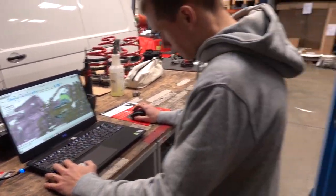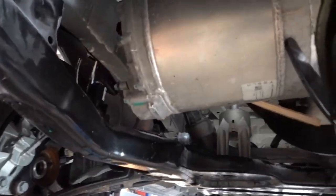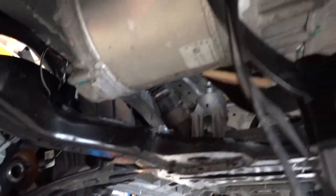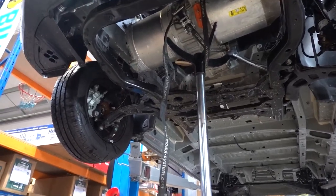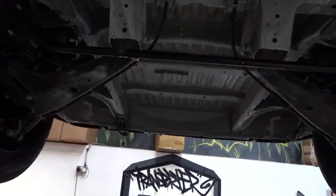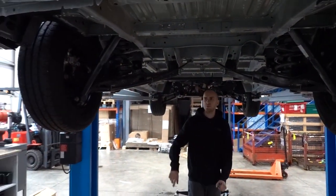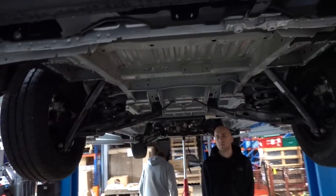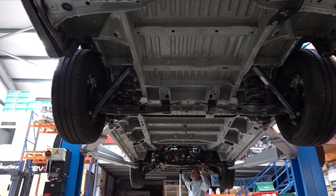Moving over to the vehicle, we now have a large Tesla Model S motor in the front here — this is pretty much where we think it's going to sit and it fits really nice and snug once you get it past the subframe. Originally we hoped to get away with a smaller Model S motor here just because of cost and space, but it just doesn't work with where the diff sits in relation to where we need the driveshafts to be. Moving on to the rear — which we thought would be the easy bit — isn't, because when you mount the large motor here it sits just 100mm from the road at standard height, and we obviously want to lower this thing quite considerably, so we're going to have to tub the rear.